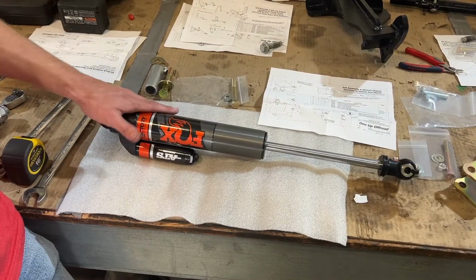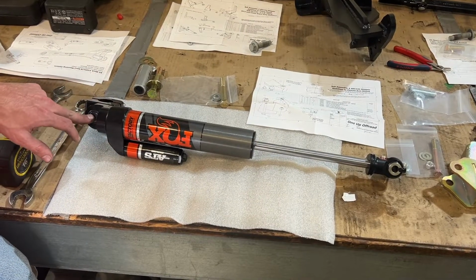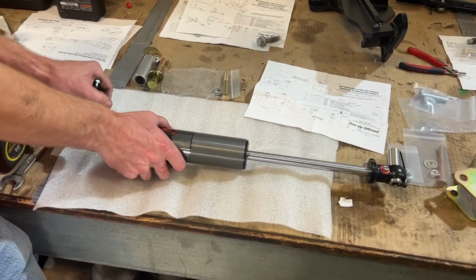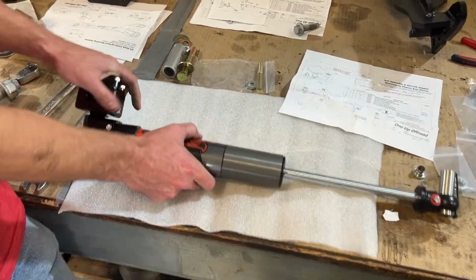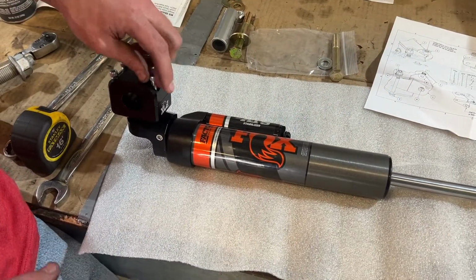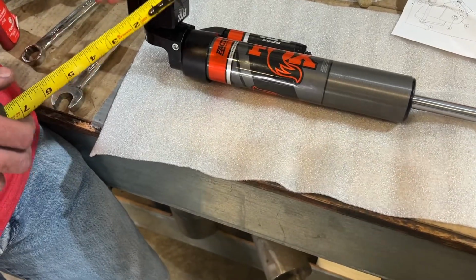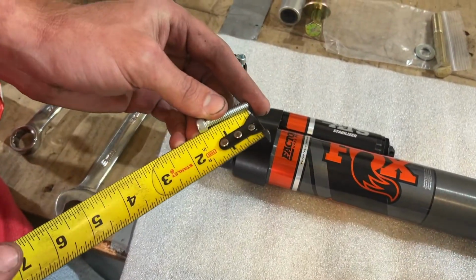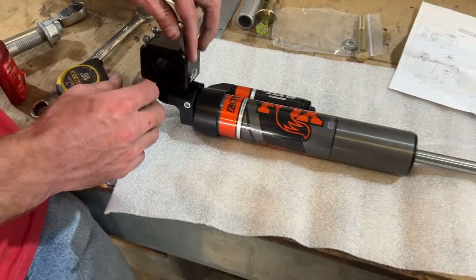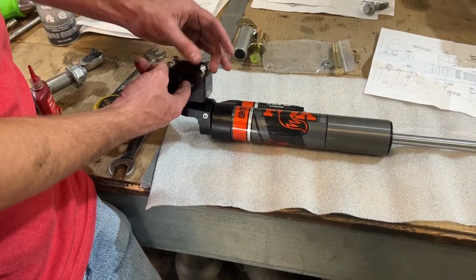We got the ATS stabilizer sitting here on the table. A few things: we already backed this bolt out, Loctited it, tightened it back up, make sure it never comes out in the truck. So it's going to be a little harder to wiggle this around now, but we'll take it. The other thing we're going to do is pull one of the 4 bolts out here and make sure the length is right so these don't bottom out. We've seen some of these assembled incorrectly. They should be 1.5 inches from head to base, and that'll let this clamp all the way down. Otherwise it'll never get tight.